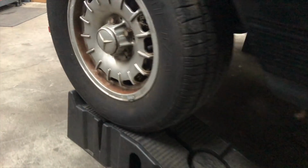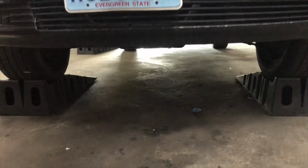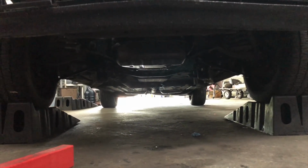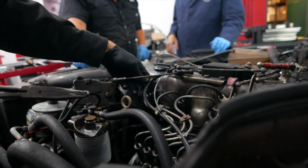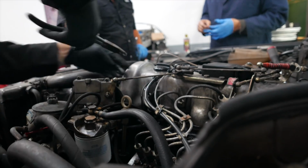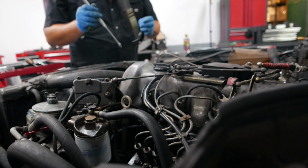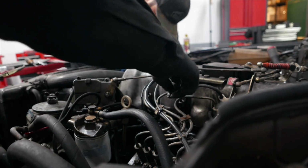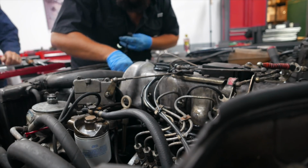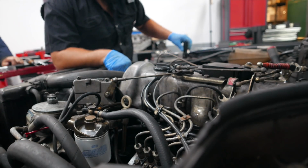You're getting ready to pull the radiator out. Okay. We cannot remove the engine with the fan on the engine. It will not clear the core support. So we've got to be able to tilt the engine up like this and out over the top. The core support does not come apart here. So we can leave the AC condenser in here, but the radiator's got to come out, with the fan shroud. And so what you're doing there is on the checklist, it's called pull fan shroud, pull radiator. So we'll have to get ready to drain the radiator here.